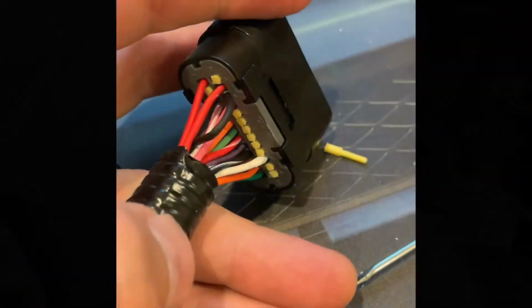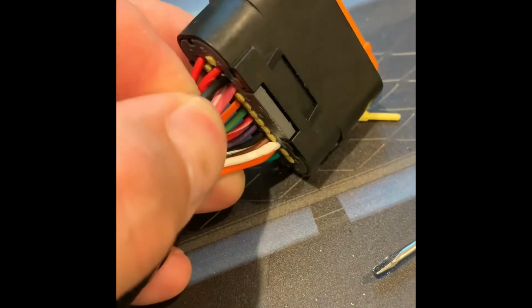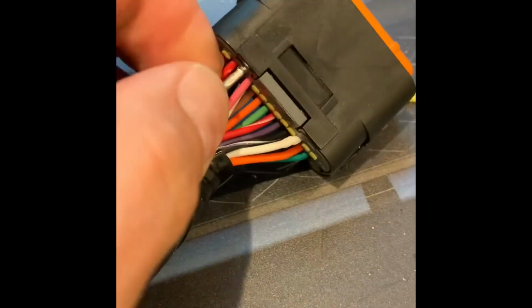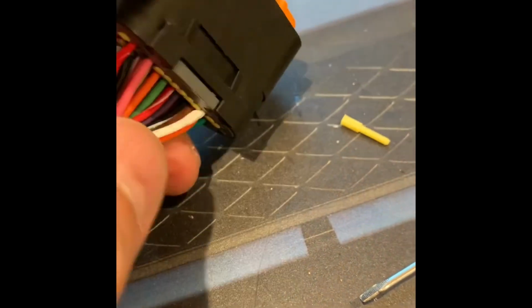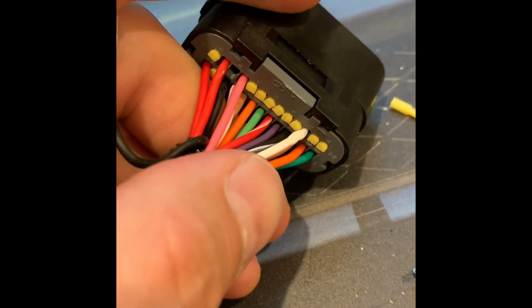That's it. Some FleetMAX that use the PBF Max hardware have pin 16, which is this one, populated with the ground. I've already pulled the retaining pin, so this needs to not be connected. Make sure that with the PBF Max hardware that pin 16 is not connected to ground.